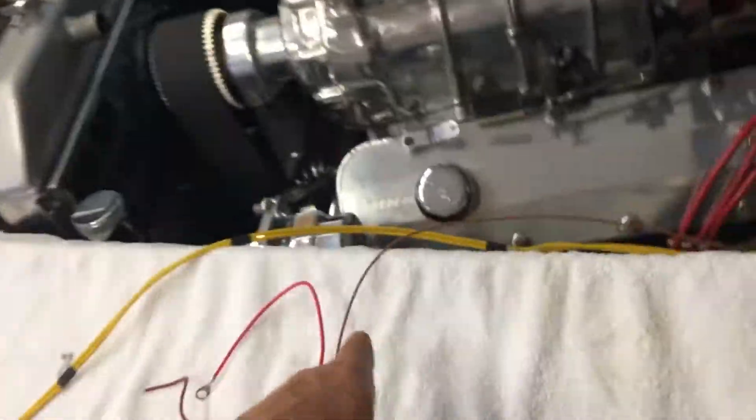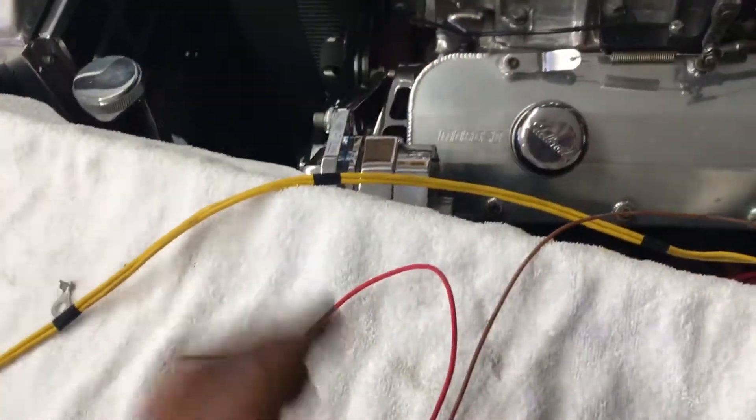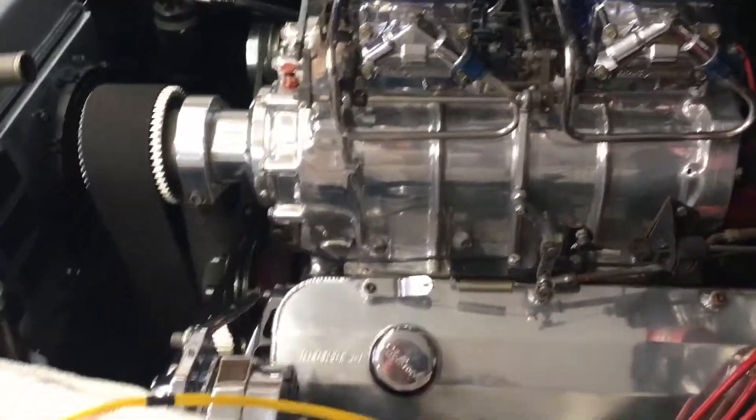You can come out here and check and see if your alternator is warm — if it is, you have it wired wrong. That's a drain. Some of these rotors are like a six-amp draw; it'll kill a battery overnight or over a weekend easily.